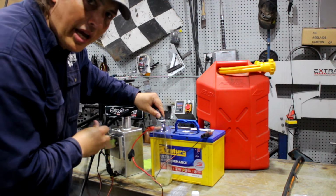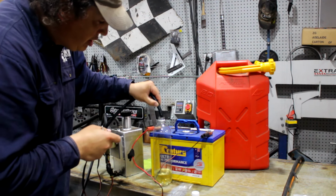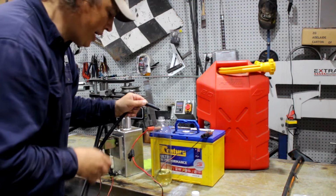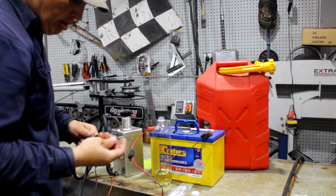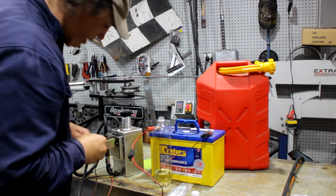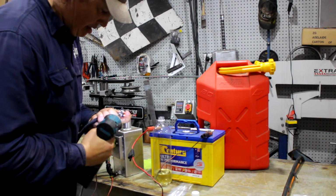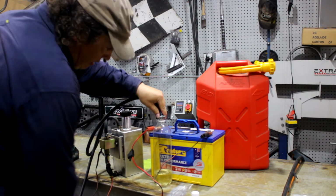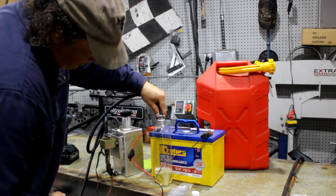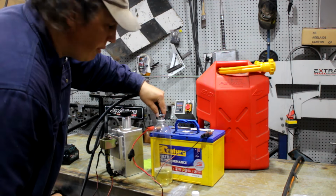Now this is okay to fill up the carby if you actually plumb it up to the carby. Unfortunately, if you're just going to put it in the carby, that's way too much fuel. So a 0.9mm MIG tip jammed in the end. A lot less flow, still a bit too much, so we need a slightly smaller hole in the end.